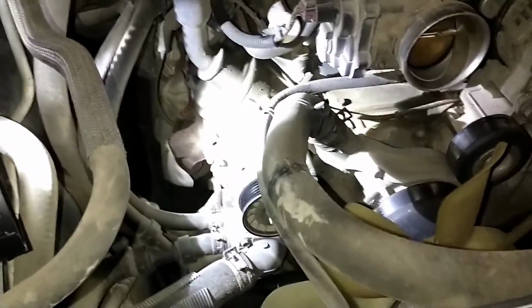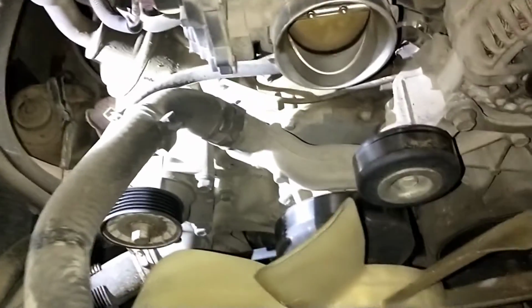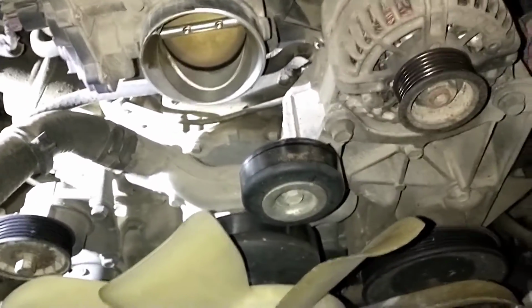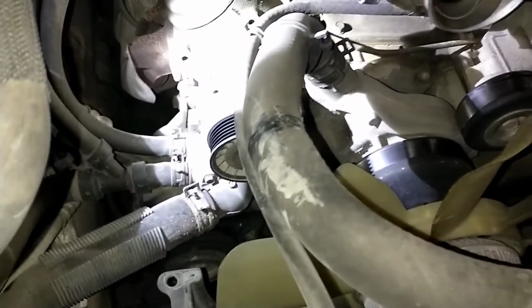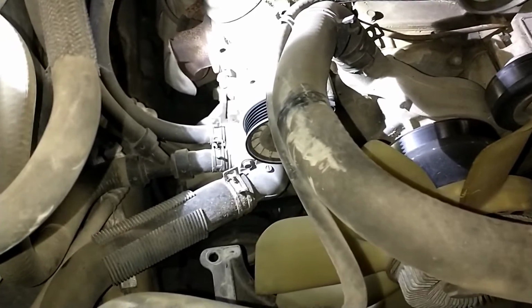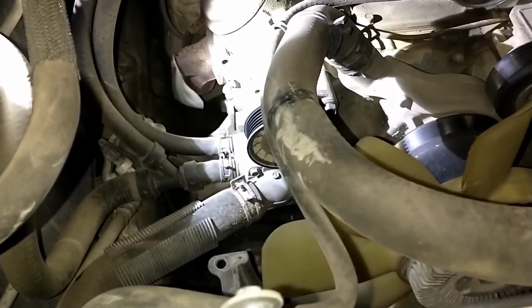We've got this started coming apart. I've got this top radiator shroud off, and of course the tubing that goes over to the air filter from the throttle body. And then this thing has apparently got a monster of a water pump. I've never really been into an LS engine much, but that water pump goes on for days. And apparently all of the hoses are connected to it: the heater hoses, the upper and lower radiator hoses. But as you see, they've got those spring clamps.